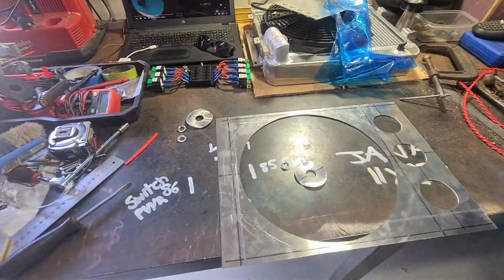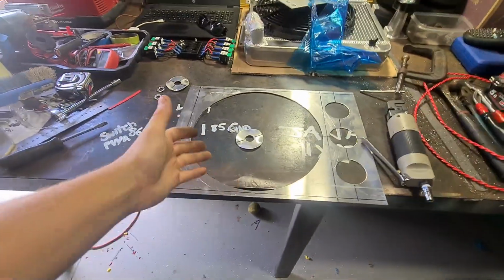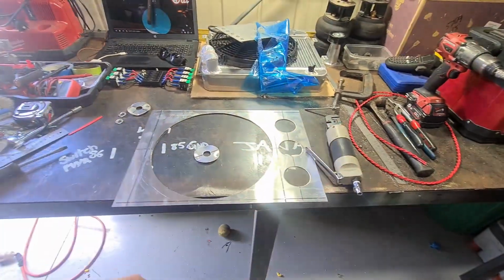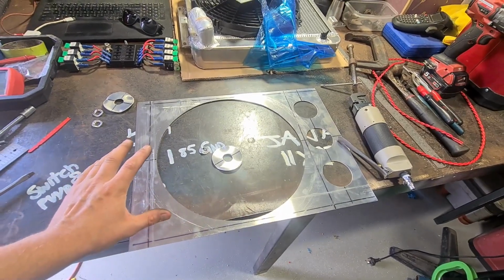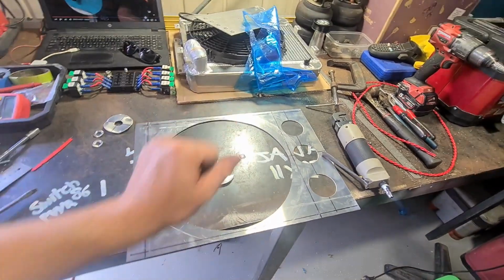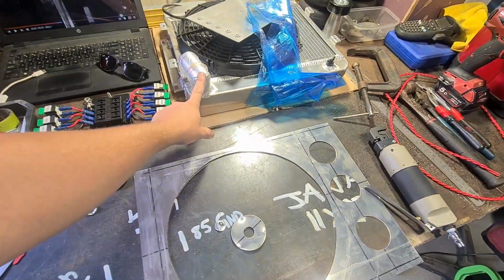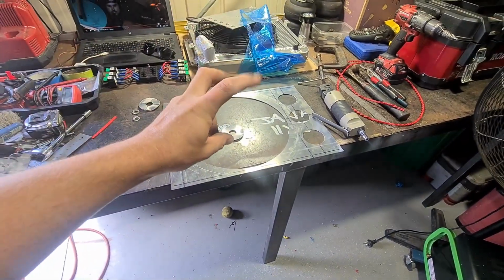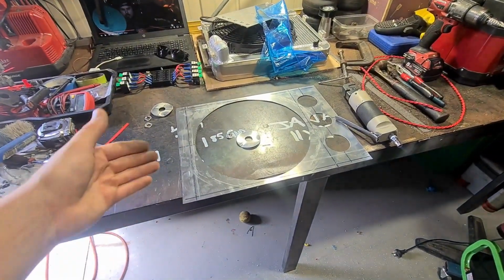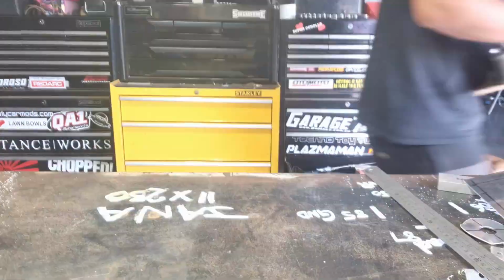So this is exactly the material that it should be using. Really thin alley, and well, really thick sheet metal also works, but that thing is an absolute weapon. So hopefully put some nice edges on this, and maybe a little bend here and there, and it should come out pretty good. But first I want to clearance this because it doesn't fit around where the hoses go. So I want to make those two fit, make sure everything actually bolts up, there's nowhere to actually bolt it just yet. And then put some flanges in it, some bends in it, make it nice and rigid.